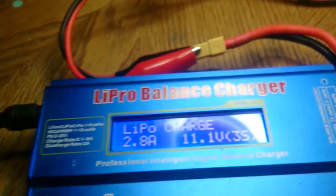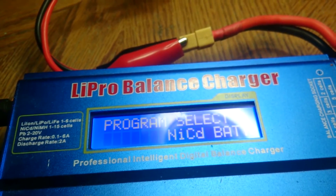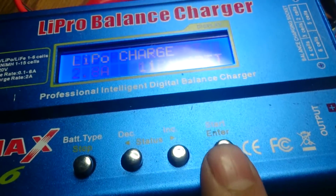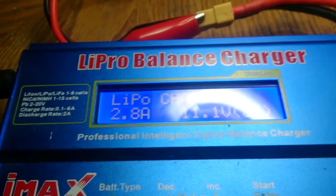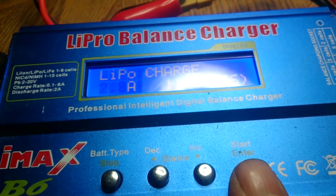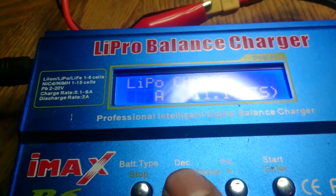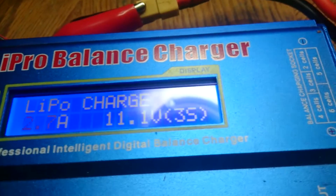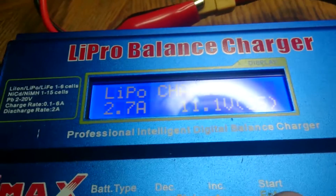Because this is the stock battery at 2,700 milliamps, you'll want to change it from 2.8. Push the battery type button and cycle through the options. I'm on LiPo — push start, then push start again. This is where you'll want to change it to 2.7. The way it's set now, because it does LiPo charge, it's not actually doing a balance charge.